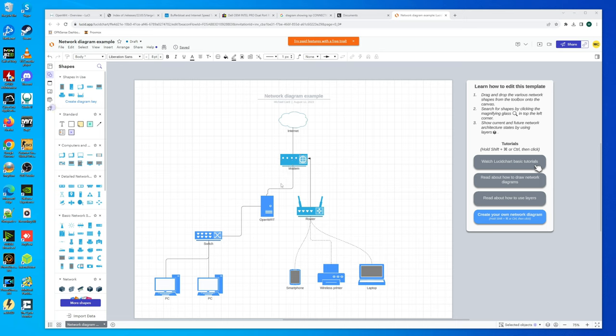external IP that the ISP gives me goes to OpenWrt. And on the OpenWrt, there's a NIC with two ports, like I just showed you. So one port is the WAN port, and the other port is the LAN port. So after my OpenWrt, I have just a gigabit network switch, and then that feeds my PCs. My OpenWrt is the DHCP server for this subnet, and the Asus router is the DHCP server for this subnet. So effectively what I've done is my kids, my family, they all connect through the internet from the Asus router, and I have my own LAN/subnet for myself. So this is sort of the topology of how this works. And now we can begin configuring the OpenWrt to help you win some more games.